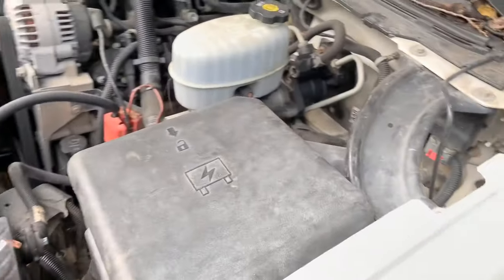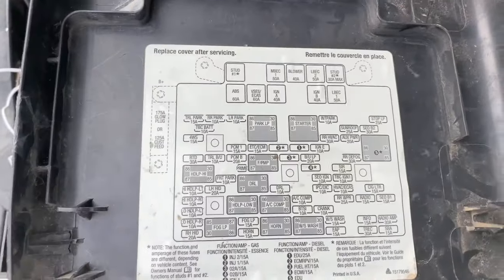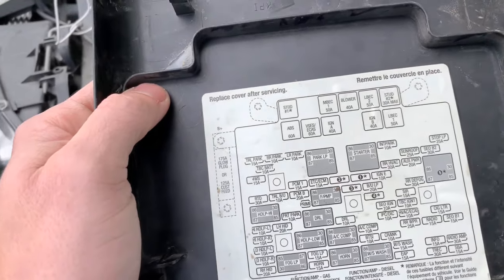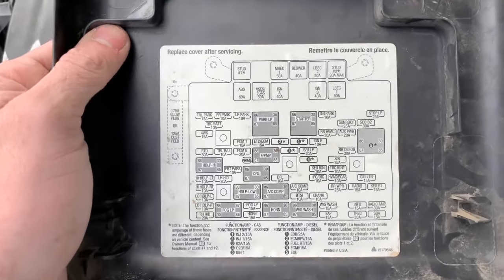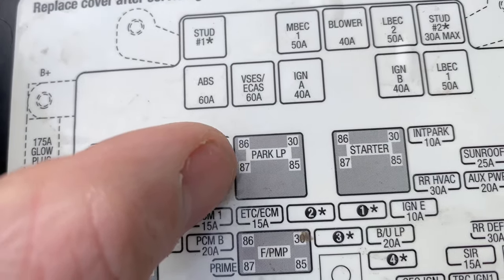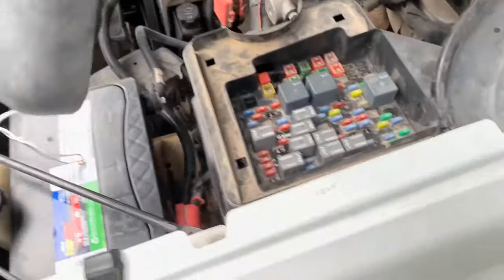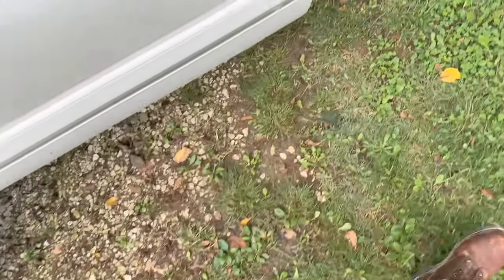That's the way you can kind of hack it to get it to start if yours has an issue — possibly with some faulty wiring. The neutral safety switch — there's a bunch of different things that it could be. But I was wrong the first time: it is going to be pin number 87. Pin number 87 is what you're going to wrap the wire around, and you can keep this in there if you need to start it again.